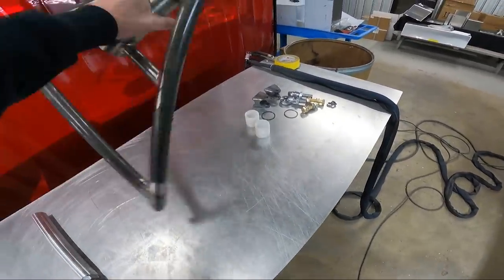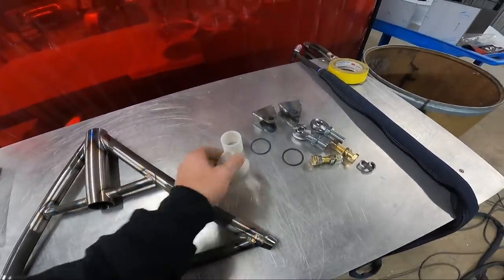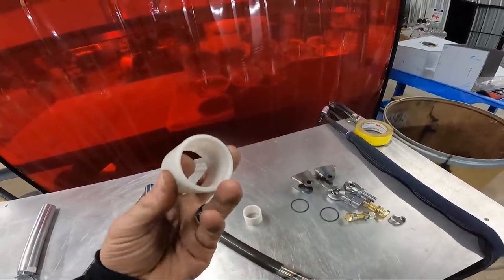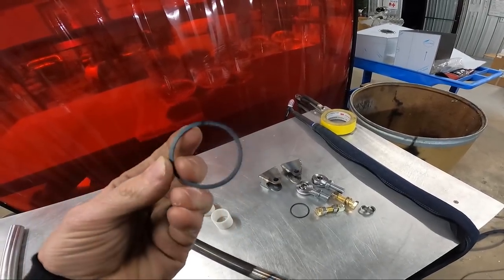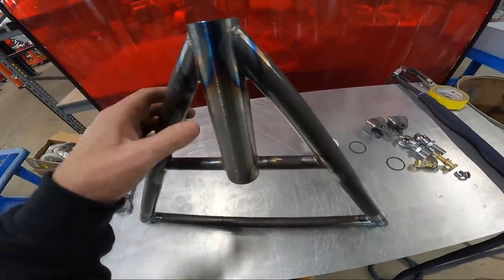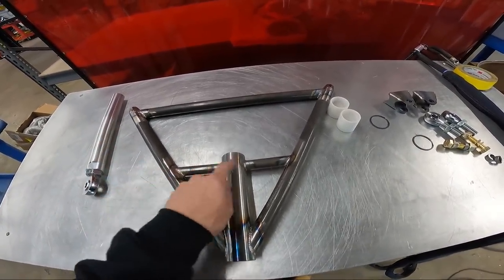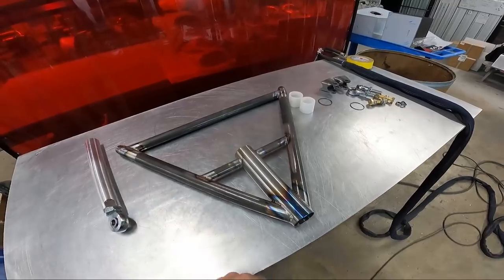Here we have the wishbone all welded up. When I got here this evening they were pretty much done welding it up. You can see these are the Delrin bushings — nice, hard, slick, just like you'd see in a steering column, so they don't require grease but they are very slidey. They've got little spiral rings here that hold them in the end of the tube. As you can see we've welded this up — this is actual moly tubing that Hammer Concepts provides. We used some pieces of our own for our design purposes, but he gives you a bunch of options as far as moly tubing to build whatever design you need.